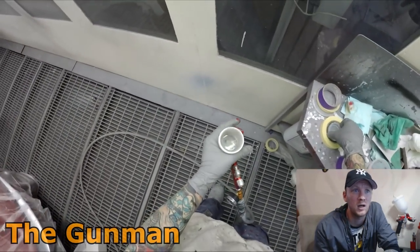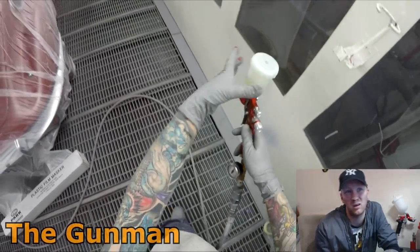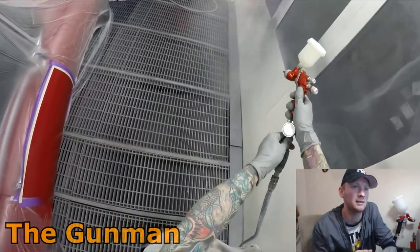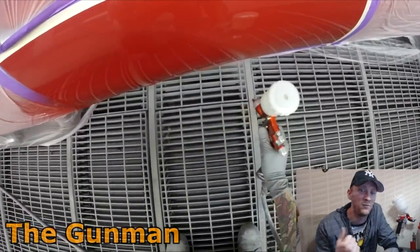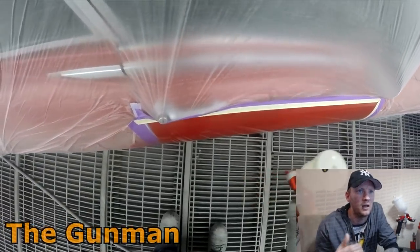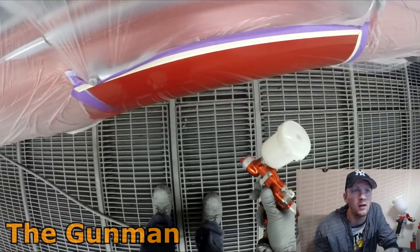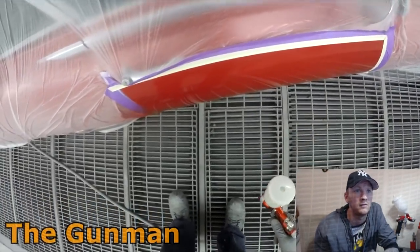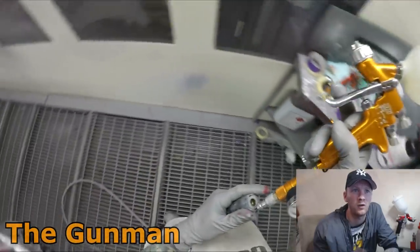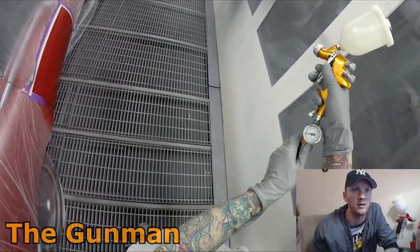So this is doing the blend — just watch what I'm doing now if you're not sure about how to do a fade out with your clear coat. In the yellow gun there — that's just some AK 350, which is fade-out thinners. You could use a 2K reducer if you like, your standard reducer that you would use to reduce your clear down with. That's at about 75% fade-out thinner to 25% clear first — that's just going to help that edge blend down a bit.